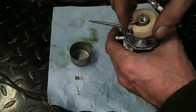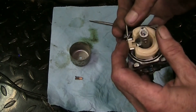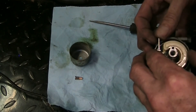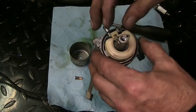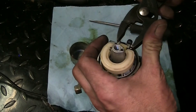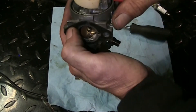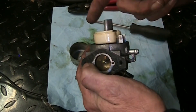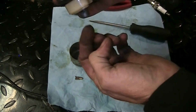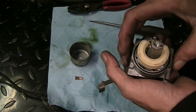Get that back down in there. Get our float pin back in there - come on now, behave yourself. Just going to give her a little gentle squeeze with pliers - don't break one of these off or you're going to be having a bad day. So the carb's upside down, the float is basically up. Blow in here - should not pass air. Doesn't. Flip it over now, the float drops - should pass air. And it does. Basic function test, it's okay.